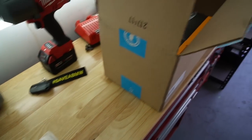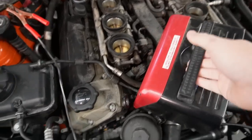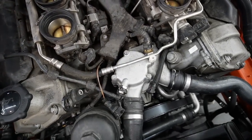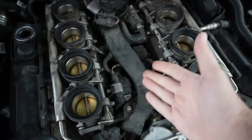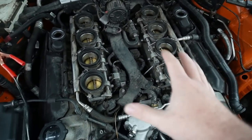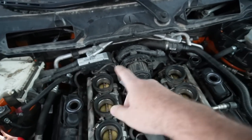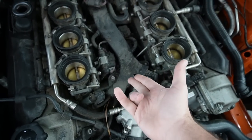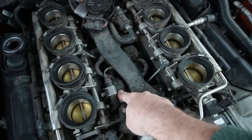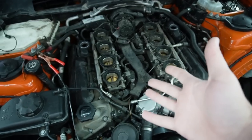This is where we left off. We need to move the intake and engine plenum out of the way. The throttle actuators are really easy to get to once you remove the intake plenum. Right underneath that you'll see two bolts, and I believe there are about six bolts total. This thing pretty much just lifts up. There are a couple of bolts holding the throttle actuators down — unplug the two connectors and they should theoretically just come out. Pretty easy from what I've seen on videos. Let's hope to God it actually is.